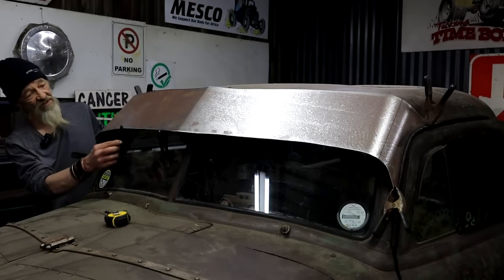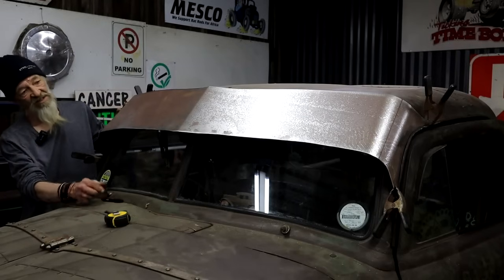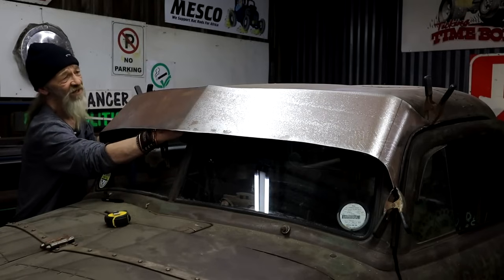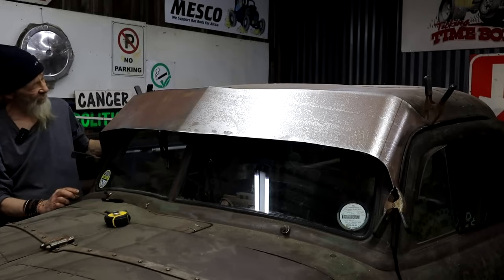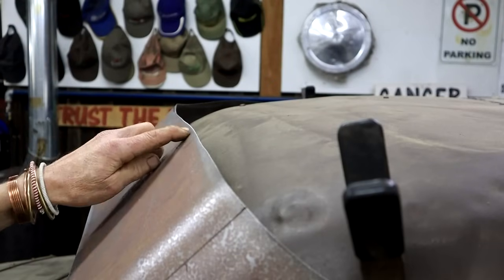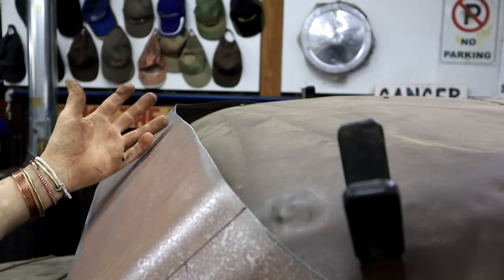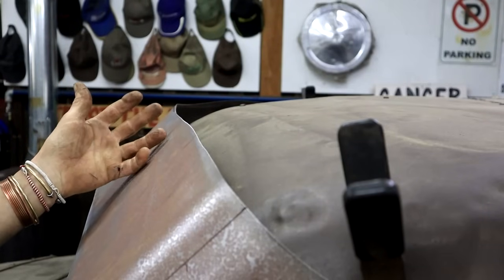This is where you light up a smoke, open a beer, or make a coffee — whatever is your poison — so you can step back and evaluate everything. Make a call on your final shapes. We can still trim it top and bottom a little bit and decide if the curves are okay. It's also still quite floppy, so I'm going to stiffen it top and bottom with some round bar. I might even add a bracket in the middle — that will stiffen it up a hell of a lot. And we've got to figure out a way to attach it to the drip rails.